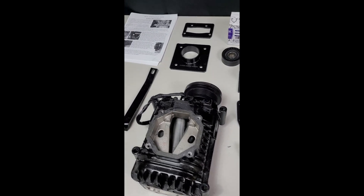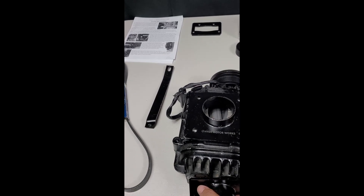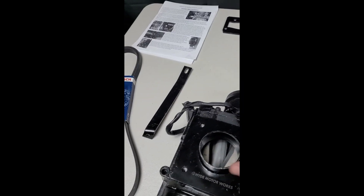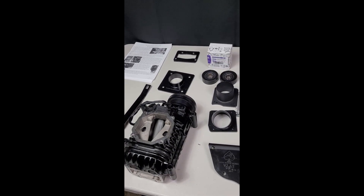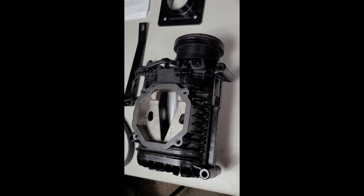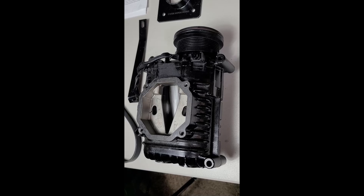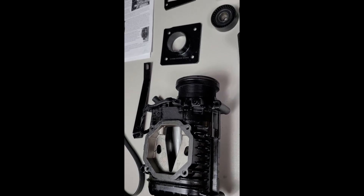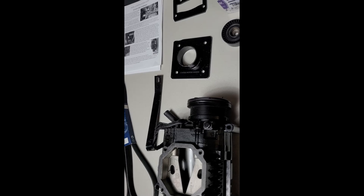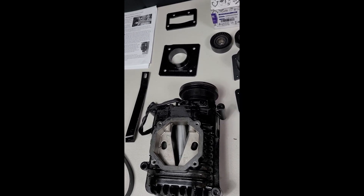A lot of these plates are pretty simple. The main plate dummies up, the other plate dummies to the back. Then you're going to send that out to your air filter and/or intercooler. In my case, we're going to go directly to the throttle body for now. This is the stock pulley system on the M62 short snout — these come off Mercedes compressors and Thunderbirds from Ford, in two different versions. The Ford one is typically a long snout version that you have to cut down. I suggest if you can get a short snout, just grab a short snout and save yourself some trouble.